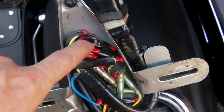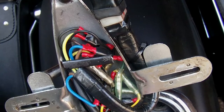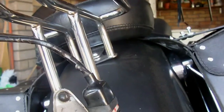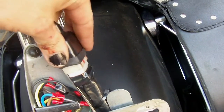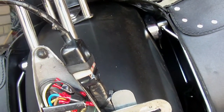That's it - all I've got to do is tidy all that up. A little bit of electrical tape around them to stop them from earthing incorrectly. Job done. Wire goes into the front of the trailer. I've cable tied it to the stay of the rear rack. That's the connector block - comes out, goes back in - so fairly easy. Just got to put the number plate back on and we're sorted.